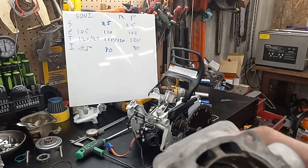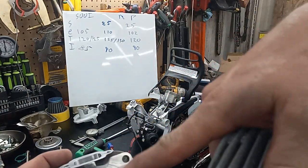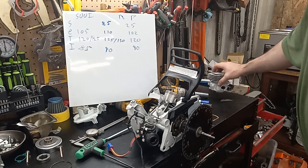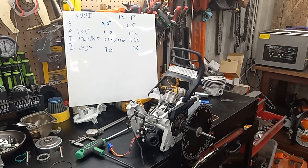This has the same amount of transfer area on both sides combined as one side of that Husqvarna — that's why I call these compromised. They're working off velocity, not flow. So if you don't have the flow, you need to start it sooner to fill the same void as if you had flow moving larger at a slower speed.